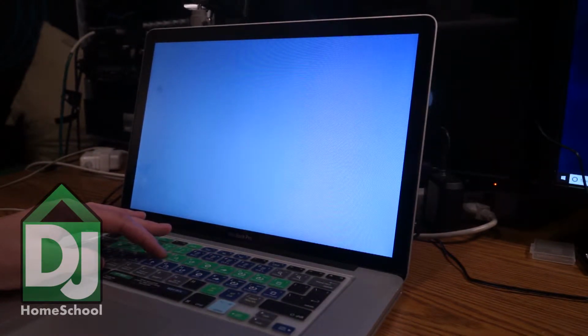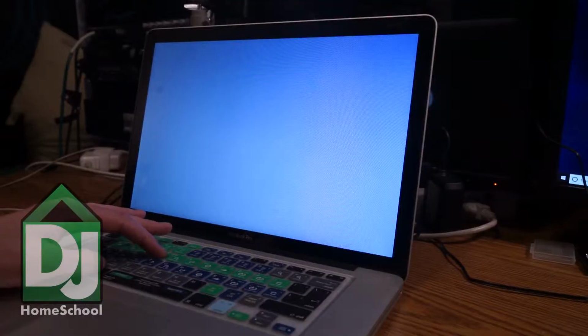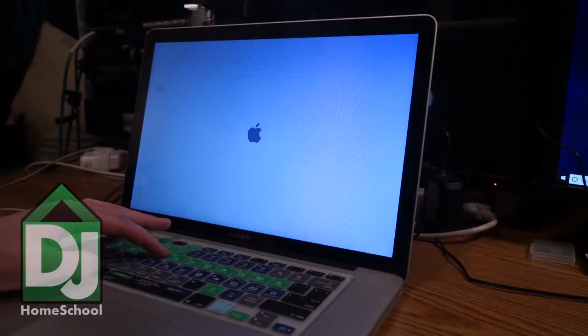So the bong sounds, and you hold Command R. And hold it. And hold it. Perfect, Disk Utility.